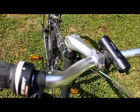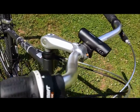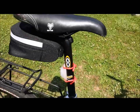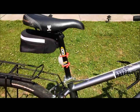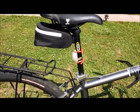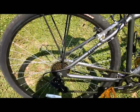It is a heavy stem — probably about half a pound — but it is stiff and does all it's asked for. The Origin8 handlebar I got for $14, and it's actually lighter than most of Easton's components. I have an Easton EA50 seat post, and the handlebar is lighter than the Easton EA50 handlebar I had looked at. The reason for the Easton post is that the standard seat post that comes with this bike is far too short; it won't allow proper leg extension, which is very key for an efficient ride. We all rode with our knees almost hitting our chin as kids — that's not efficient.